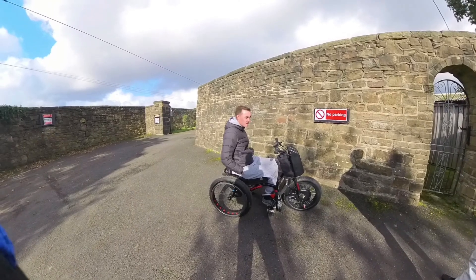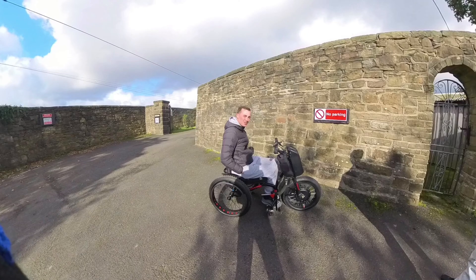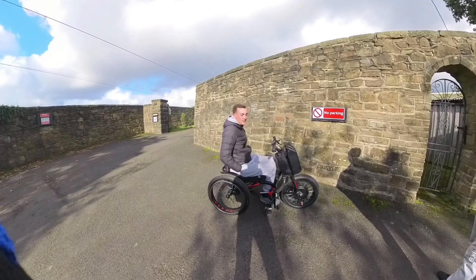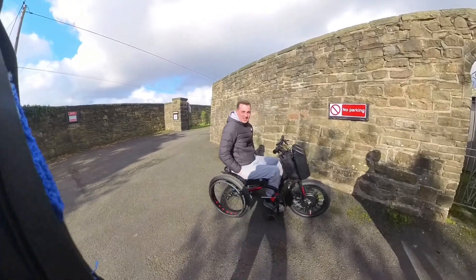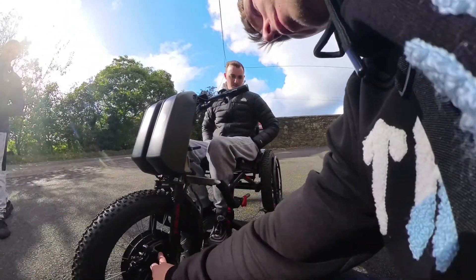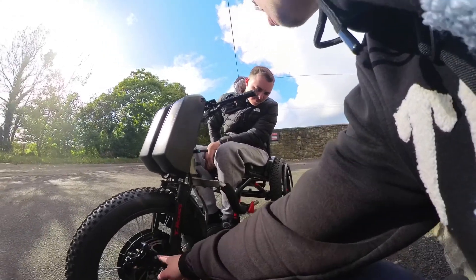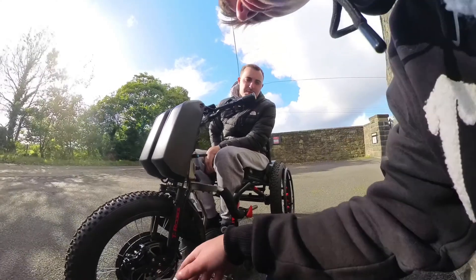Some rubbish Chinese brake. I went with hydraulics, but even the hydraulics they put on there were not even. Who did you get to fit them? Tri-Ride themselves. Your old one was a 160mm rotor - 140mm actually. This one's a big 200. They didn't even put any bracket in whatsoever, just lifted it up on spacers either side.